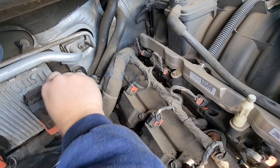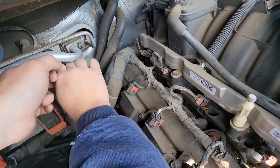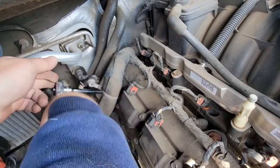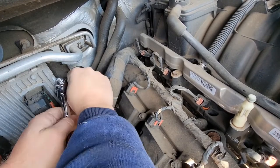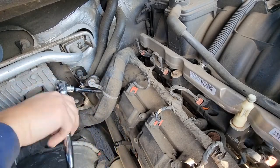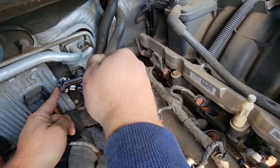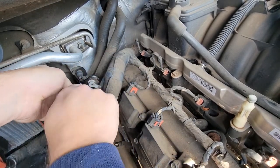Putting it back in, same thing - and your magnetic bit. Tighten it by hand as far as it'll go. These do have crush washers on them so you'll feel when it bottoms out. You'll feel the crush washer giving, and then right there the crush washer is done and you want to torque it to your manufacturer's suggested spec.